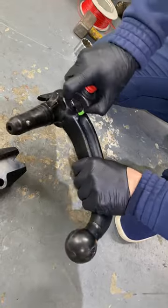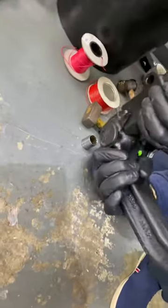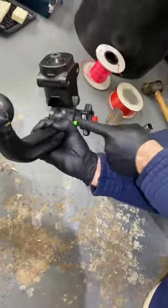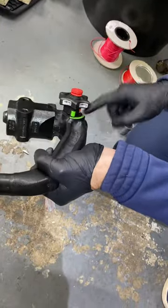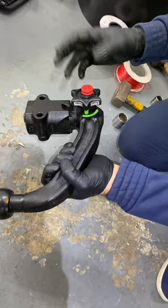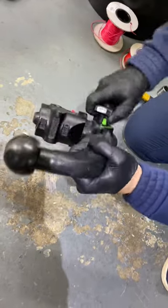If you want to get it prepared to go into the car, pull this up and then rotate clockwise so it clicks. As you slide it up it should automatically click. Very important — that needs to be in the green. If it's in the green it's locked and secure; if it's anywhere else it's dangerous and shouldn't be used for towing. Rotate the key, pull it out — that's it, locked in position.